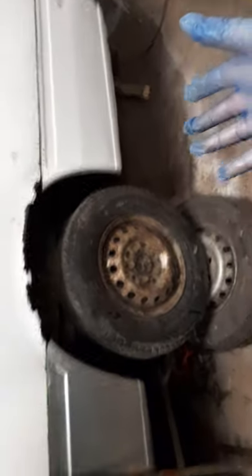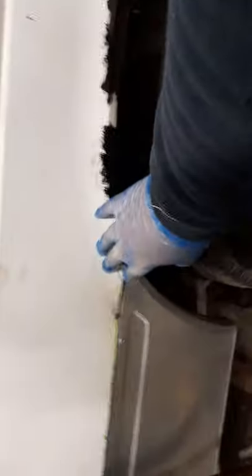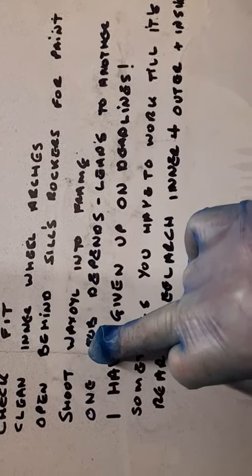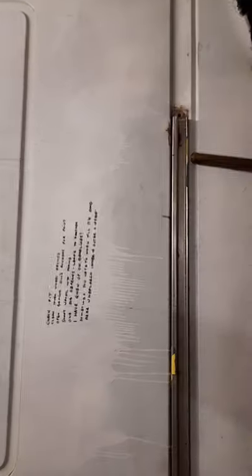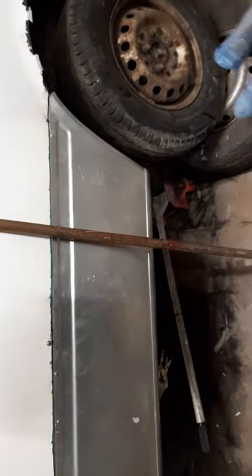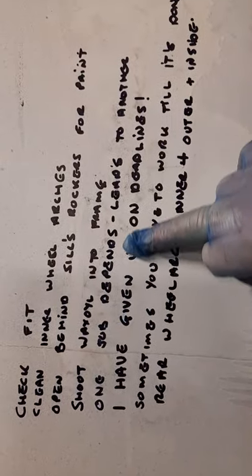Sometimes one job leads on to another job. It's good that we're moving away from underneath the van. Tonight's job will probably be cleaning the inside of the arches with wire brushes, then wiping down any excess that runs down inside the panel with a rag. I'll also shoot wax oil onto the frame on any exposed areas. Important caveat: if you weld just after you've used seam seal, wax oil or petrol, you're going to set the project on fire. Give them a few days to dry off and keep corrosion protection away from areas you're going to be welding.